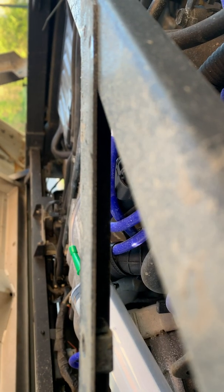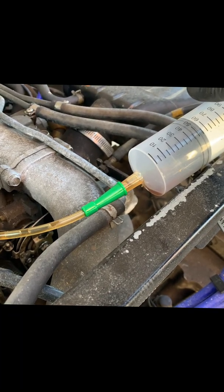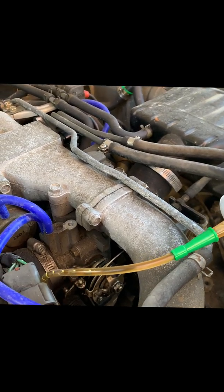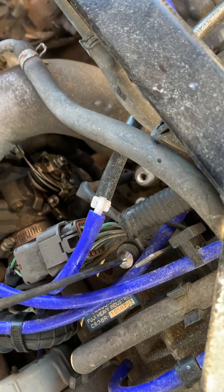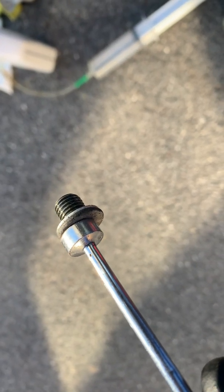I would suggest poking a hole further down into that tube and then use your siphoning action. Draw out as much of that old fluid as you possibly can. This was actually part of a kit from Amazon. I'll leave a link in the description. This worked so perfectly. The fill bolt on top of the supercharger is the 6mm hex bolt.